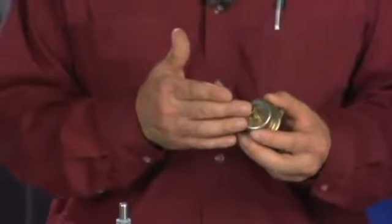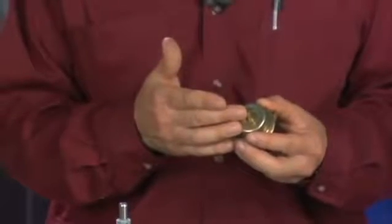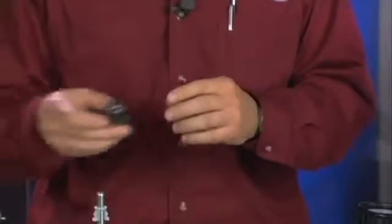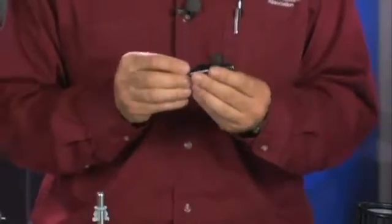One of the problems that they can have is that if it has a vacuum port to it, we could leak fuel out this vacuum port, so we should check that to ensure the regulator is in proper operation. The injectors themselves are what delivers the fuel to the engine. One of the ways to make sure we have good drivability after fuel pump is replaced is to clean the injectors to make sure there's no contaminants on the pintle of the injector.